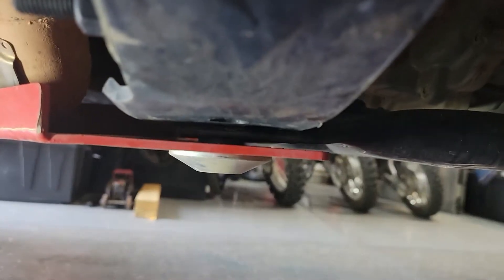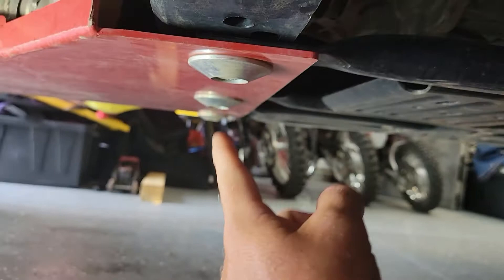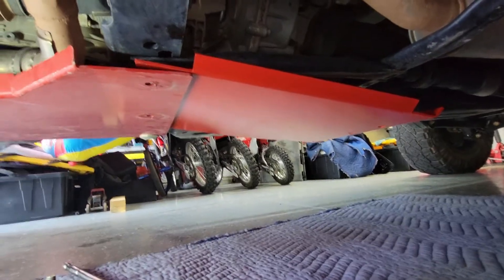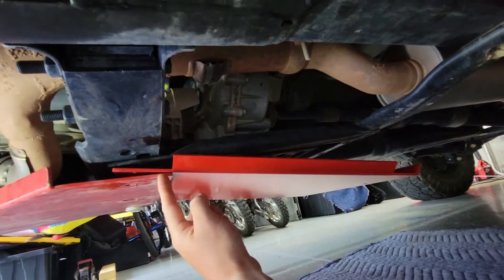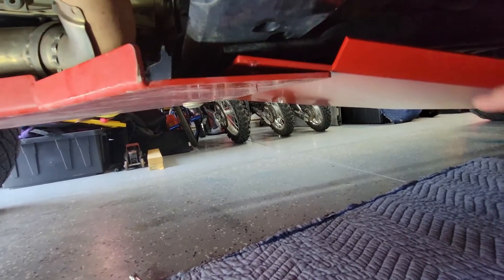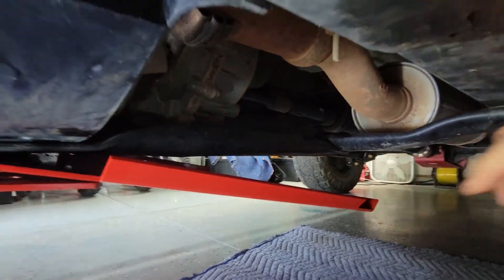As you can tell, we did have those spacers in there before — they're kind of hard to see, just barely in there. We're going to be removing those two, but the third one will stay to keep that at the right space. I did remove the rear two bolts; the third one on the far side still is in place. I've just lifted this up into place, removed those spacers, and then we're going to put the spacers on the back, lift that up and bolt it in.